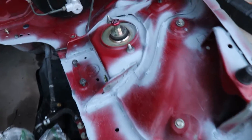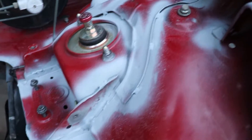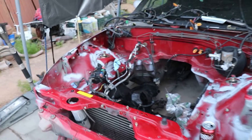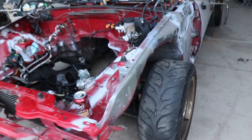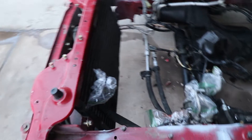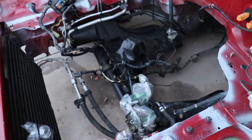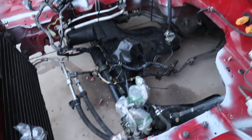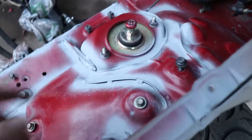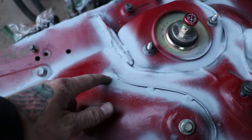I'm going to call it a day because the sun's going down. Got all the stitch welding done and got it all primed up. Tomorrow I'll just give it a quick scuff. I'm not going crazy with it — just a nice scuff and shoot. I've got to get some aluminum foil to wrap things semi-neatly, mask off the condenser, and throw a tarp or something over the subframe and AC lines. At least the welding's all done.